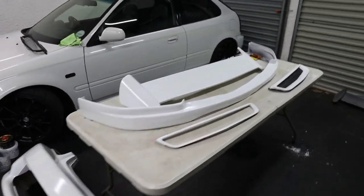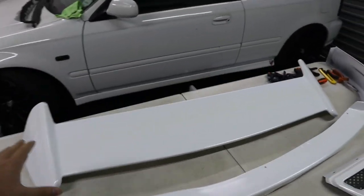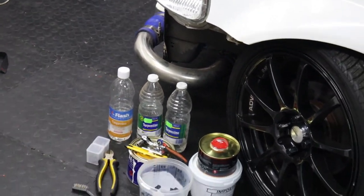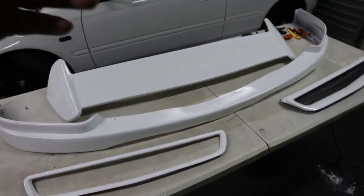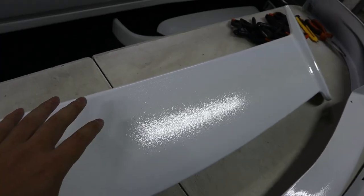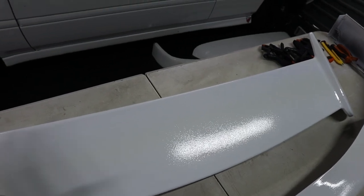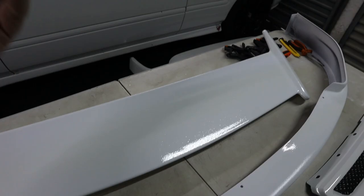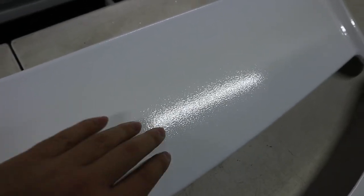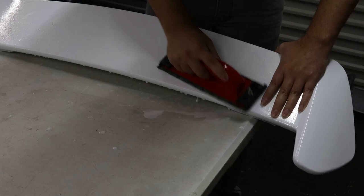It's the next weekend and we should be ready to fit everything, but we ran into difficulty while painting. When I started mixing up the paint I thought I had enough thinners, but I only had one bottle — not enough. So the paint was too thick, and as you can see there's extreme texture because I didn't have enough thinners to thin it out. The thinner the paint, the smoother it lays but the easier it runs — you need that balance. Since the paint was already mixed I had to go ahead anyway, and now we have this super rough texture. We're going to have to wet sand and buff the wing — that's going to be three hours for me, but about 10 seconds for you guys.